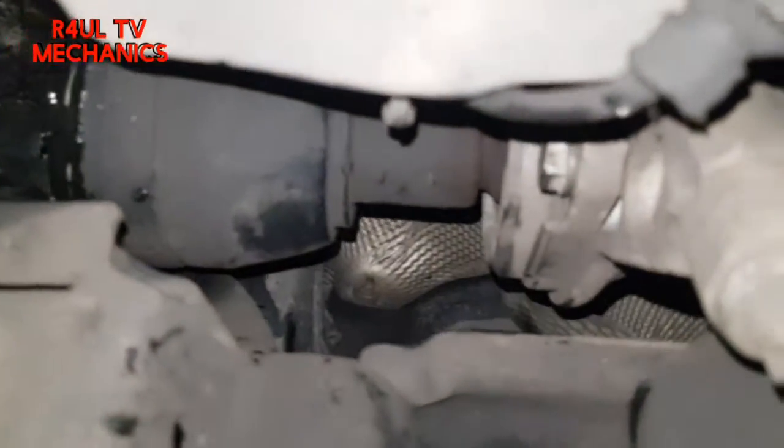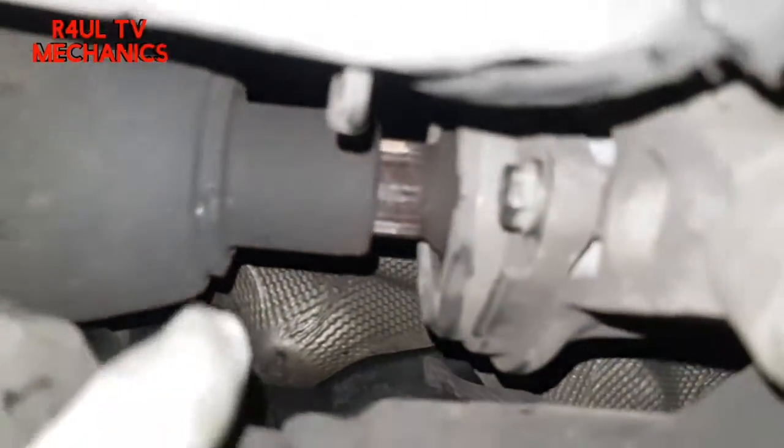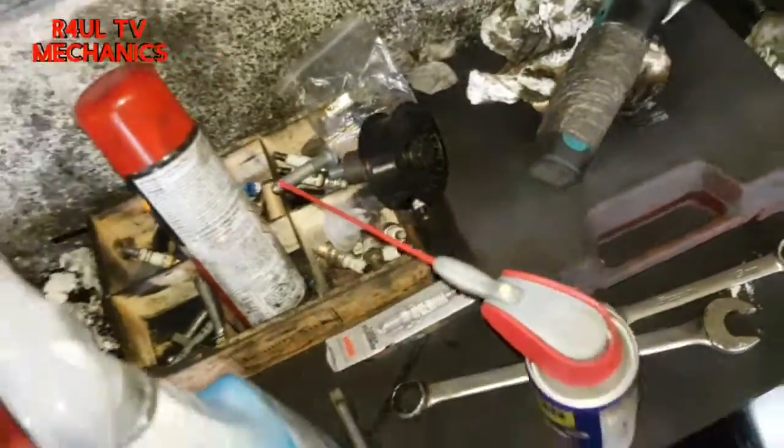After we get the drive shaft — it's not supposed to come off, but because it's all collapsed, it has. So what we need to do is take this part off here. Give it a little hit and it should come straight off — it just slides onto the inner shaft. I'll give it a pry with the pry bar and a little hit with the hammer. I just got the pry bar in there and gave it a little hit with the hammer — that's come away. All we do now is take it off by hand. Nice and easy — happy days.